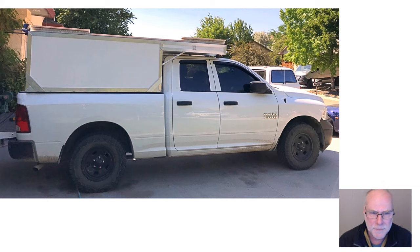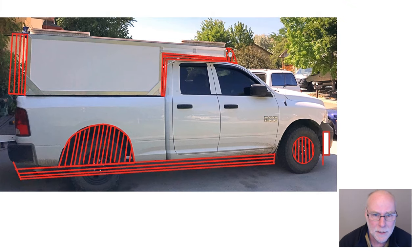I'll talk a little bit about the back of that body in a moment, but those are the most major things that come from that attached body. Looking at the truck itself, let's have a look at my drawings. I've got the rounded edge at the front and it should be rounded down that side. I've filled the gap in there as I suggested. Now for the truck itself, I'd be putting some air curtain guides — some external guides — to try and smooth airflow past the front wheel. I would cover that front wheel with a disc cover, leaving probably a few holes for brake cooling. And I would put a very deep front spoiler.